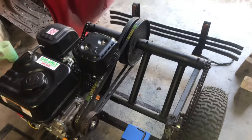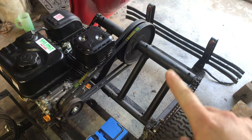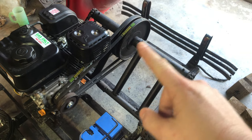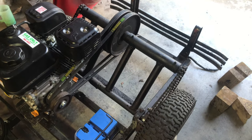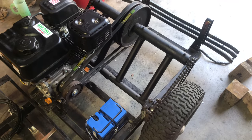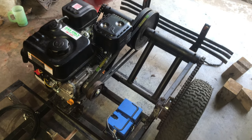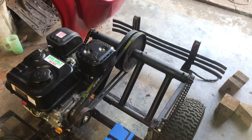I thought I'd mention while I have the body off — this mechanism here adjusts so it will pivot either way. These are 50-inch belts on here. To tighten the belt and the chain, we can move that a little bit. It comes real close to the body but it misses. This is original to the way the Disney car was, and it's just been modified slightly so that we can adjust. Those didn't move before — they do now.